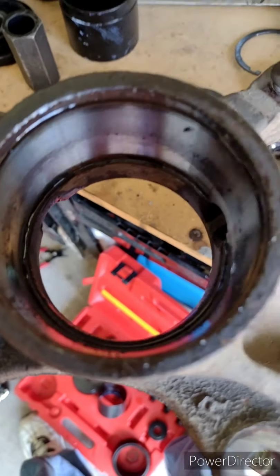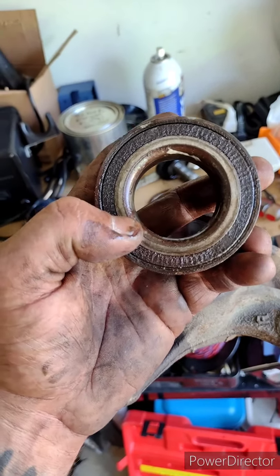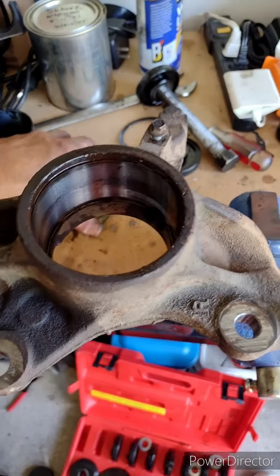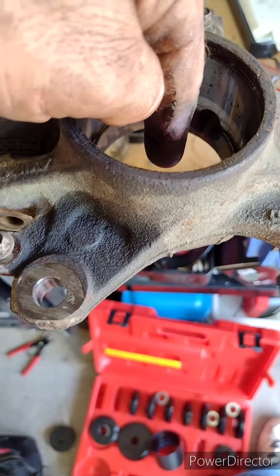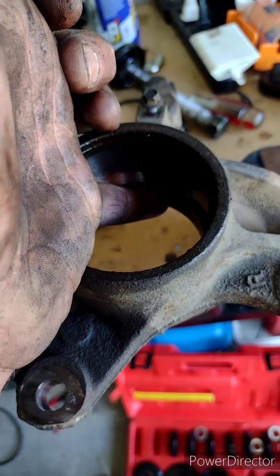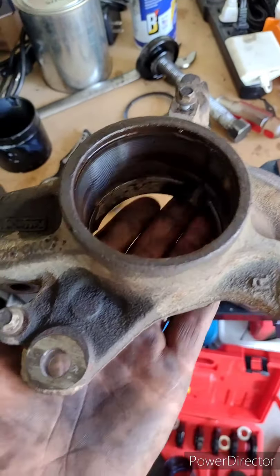But on these bearings, be mindful. One side has an ABS sensor track. It will be the magnetic side, or the brown side, or possibly orange side. That side, the brown and orange side, or whichever side's magnetic of your bearing, must go in first. The other face will be up here. The side that reads the ABS sensor comes out of that hole right there. So that ABS sensor track needs to be on the bottom side.